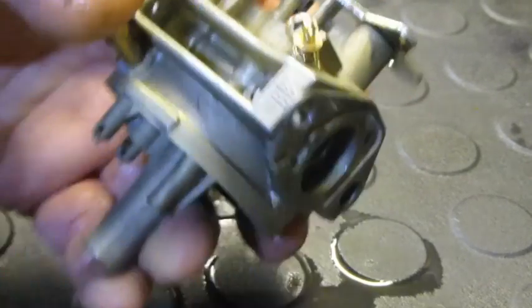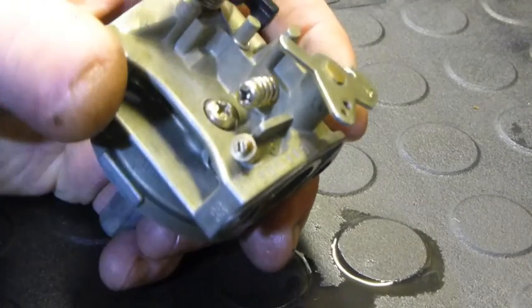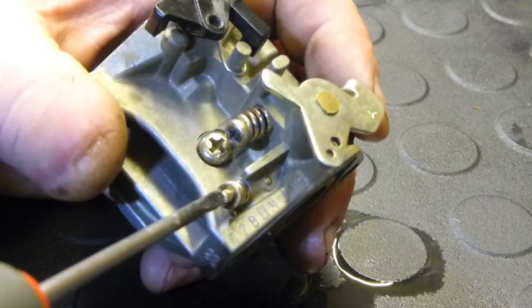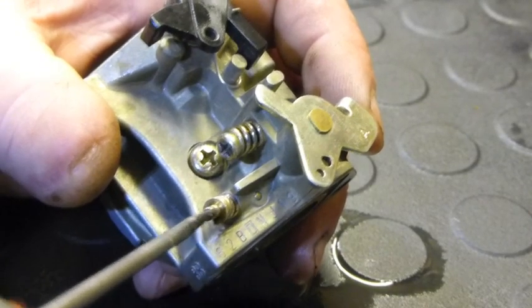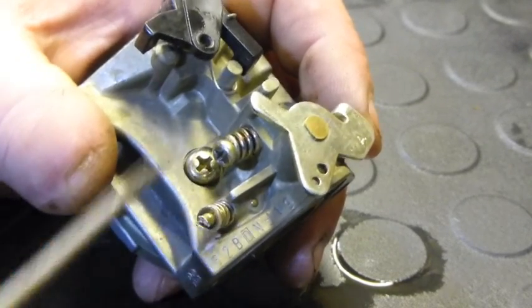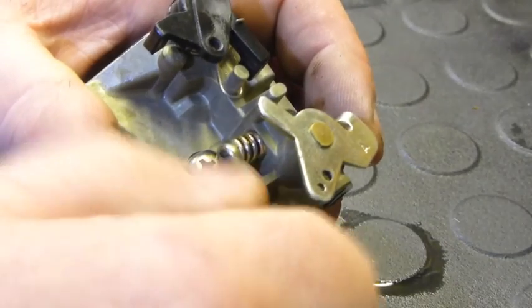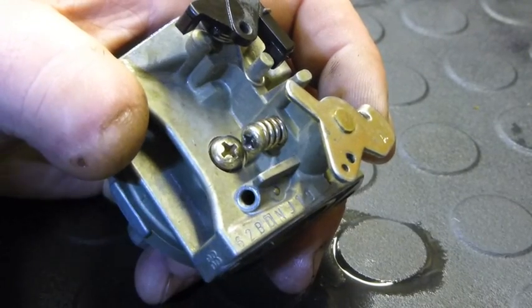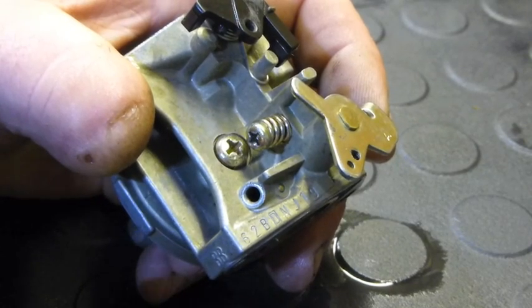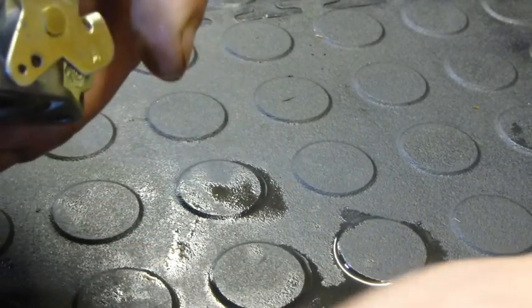So that bit's clean. The only other thing to clean is the low speed nozzle — the idle speed nozzle and jet. The idle speed jet is the one you adjust for idle speed, and it normally has an aluminium cap on it. I've already removed this one previously. The aluminium cap is a limiter with a little tag out the side that allows 90 degrees of rotation. The way to get it off is to heat it with a soldering iron to melt the loctite bond, then pry it off. If you try without doing that, you will bend and break the needle. Alternatively, you can cut the little tag off the side of the limiter with a pair of side cutters in one nip, without putting any sideward pressure on this screw — because this screw will break off just underneath the head if you apply any sideward pressure.